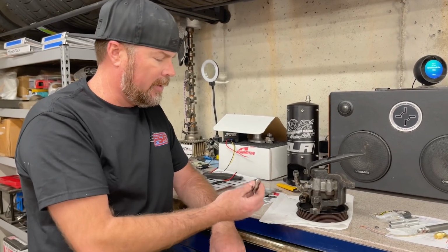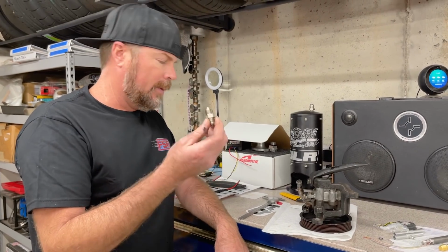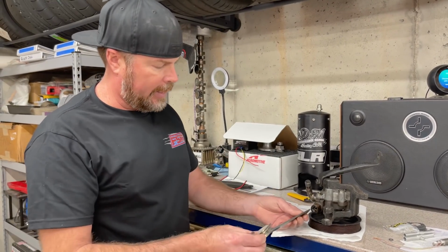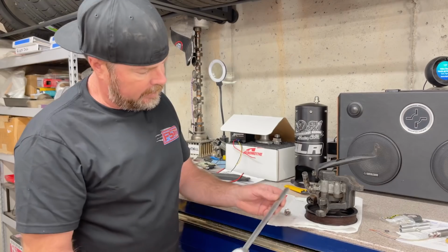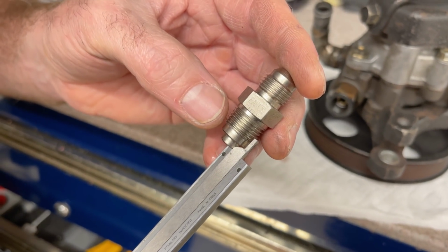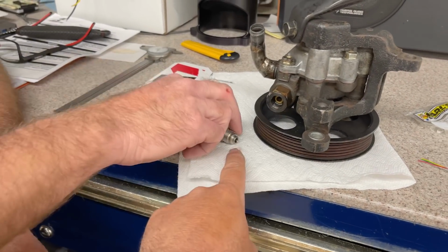Right. We'd be geniuses. So I'm going to go take this and death wheel it all the way to the threads, because we can't have any of this bottom out on the flare that's there. If this does ever leak, then maybe we find the right fitting and it just threads right in there and seals, and you don't want to wreck that. So we're going to cut it all the way to the threads there, because my handy dial calipers say from the sealing surface to there is about that far, which means that extends way down in there. So we need to cut it at least to here, right about there. We need to cut it there. And then it should work. And I'm pretty sure they do have a fitting that is metric, that is inverted flare. We just don't have it today, and we want to make this run today.